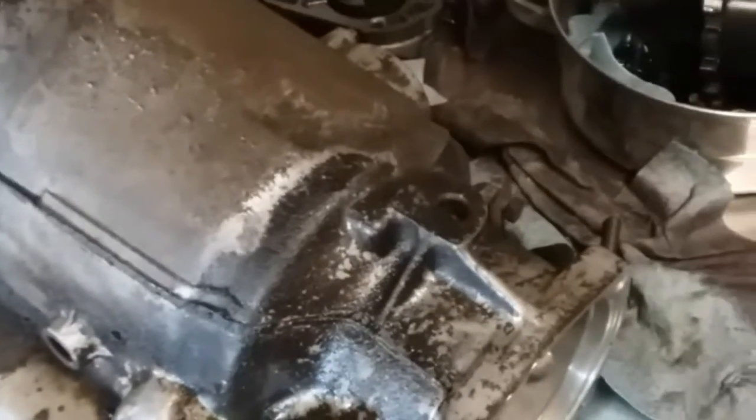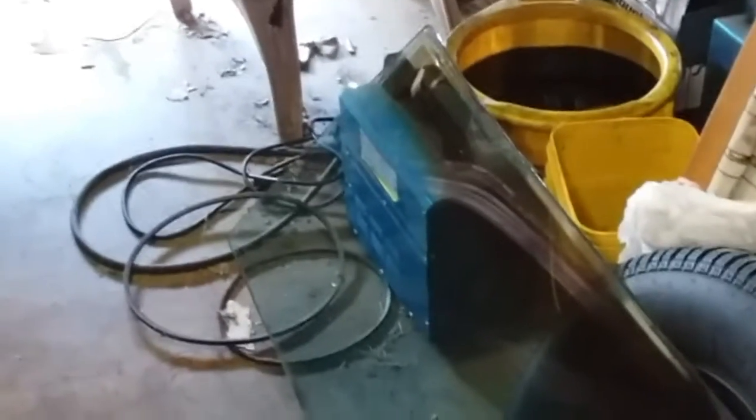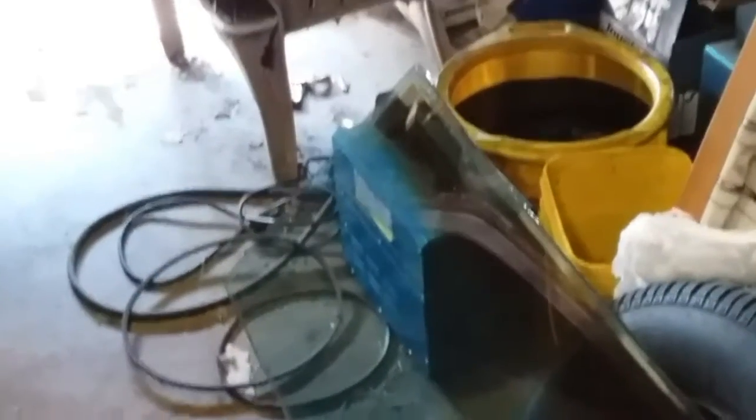But instead of rebuilding this Turbo 350 for the Nova, one thing that I don't think I've ever heard of GM doing is putting an overdrive transmission behind the inline 6 250, 4.1 liter. So I was looking at the different items that would need to be there for that. Bracketing, as far as for the throttle valve cable, is already there because this one had a kickdown cable. So that's not an issue. Linkage on the carburetor, same deal. It's already there.